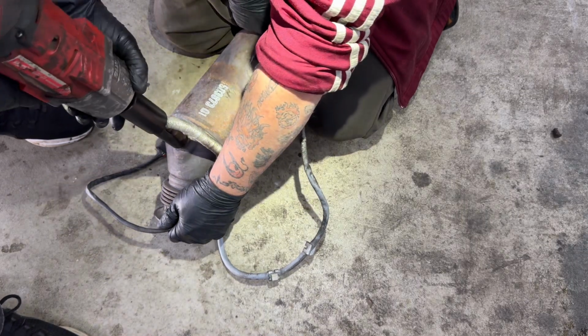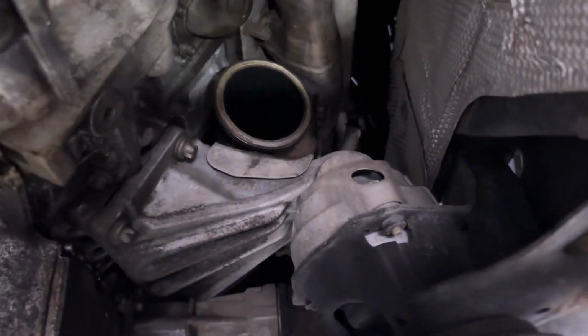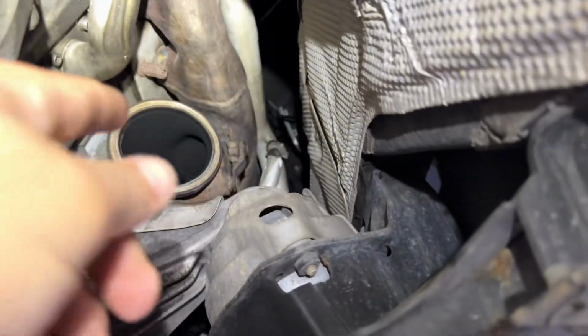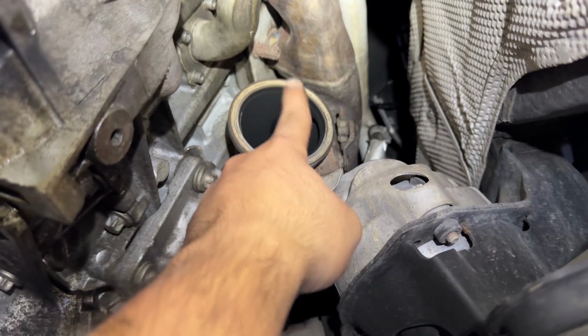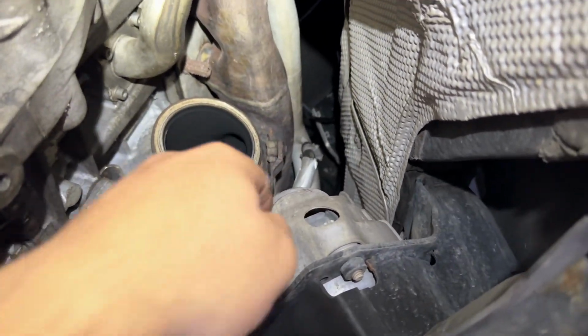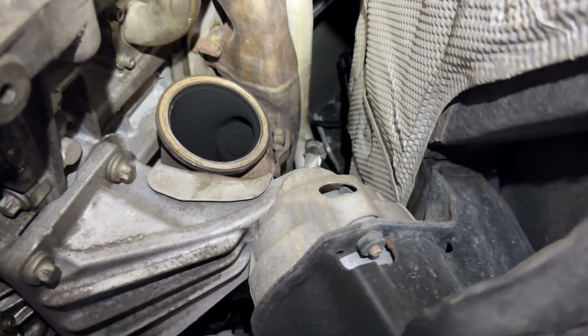Nope. Expanded. All right, you guys, now that we have the catalytic converter off, that's where it sits. That's where the V-band goes around and then locks in the bottom here, that 13 millimeter. That's a gasket we're gonna replace, which I'll also include the link in the description below for it. The V-band also I'm gonna replace. I'll also include the link in the description below for that as well.